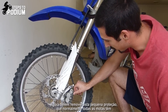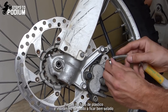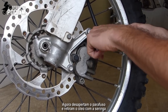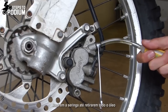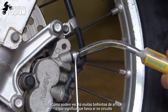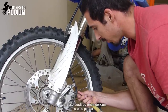Now you remove the small protection that usually comes with every brake, and you insert the 8mm wrench. Usually it's always this size. With the plastic tube, make sure it's well tight. Now what you're going to do is unscrew this bolt and let the old oil get into the syringe — just pull it and it all comes out. As you can see, there are a lot of small bubbles, which means there was clearly too much air in the brake system. Be careful not to spill this oil because DOT 4 brake fluid is a bit corrosive, so be careful where you let it drip.